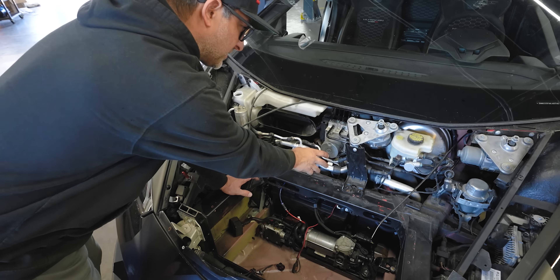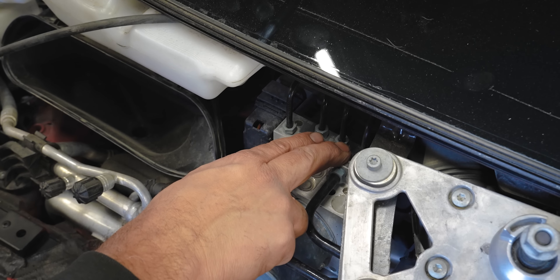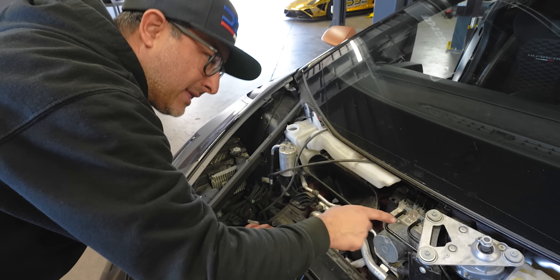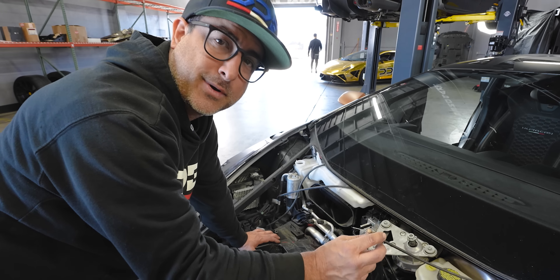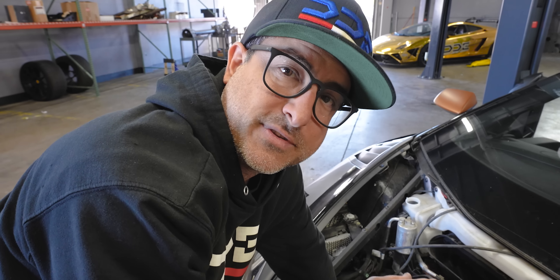The ABS pump in this car is actually in the center, which is unusual but really easy to get to. The HL and HR — that's the rear left and right rear — those two lines are going to have to get disconnected and interrupted. We're going to take those two lines out and route them into the car, and the two open lines from the pump also get routed into the car — making those lines longer to attach to the e-brake since it's a pass-through system. We'll have to go down and over to avoid the windshield wiper motor. There's actually a hole in the firewall that was the factory hood release — since this is the Street Evo with a pin-on hood, we can use that hole for all four stainless braided lines.